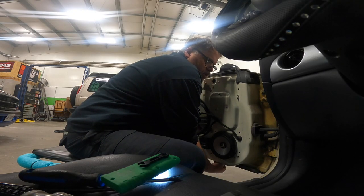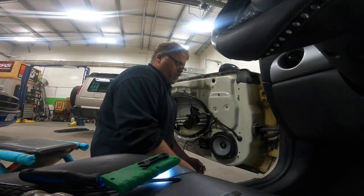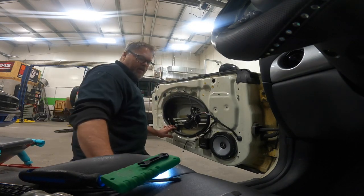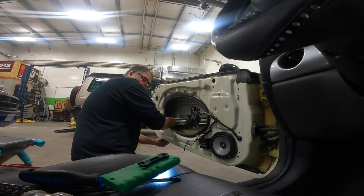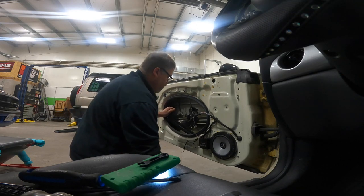Basically if you leave that loose down there you can tilt the window in and out like this from the bottom. On this car we're going to have to adjust it because this car has been kind of a little difficult. So we'll get that started. Now we'll get the other side in. Just so you know, when the new door regulators come in they come with a 10 mil bolt in them — so make sure you pull them out, because you'll put it in and then realize you have to pull it out to get the 10 mil out of it.